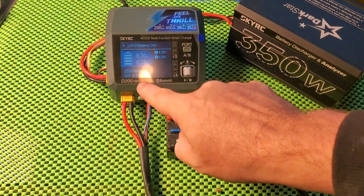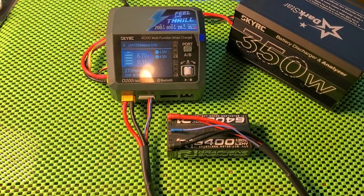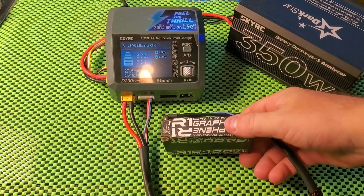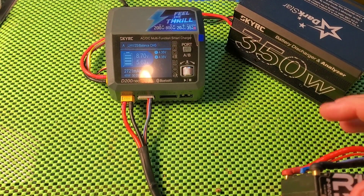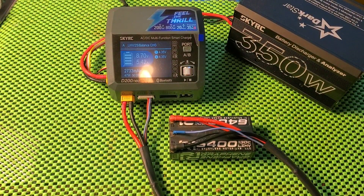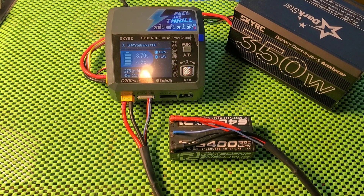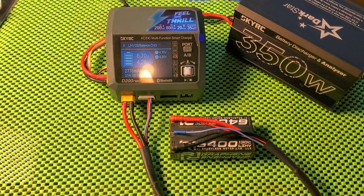You can see the charge is only nine minutes so far. We're down to six amp. Now these R1 batteries are very good quality — they can handle a 20 amp charge, not a problem. The charger is pausing at around five amp. We can see it dropped down to four now. It's like watching paint dry, or grass grow — watching your battery charge.